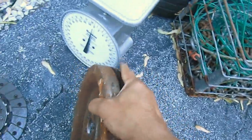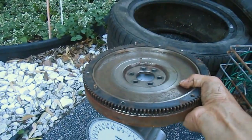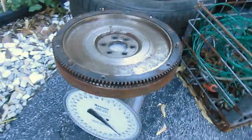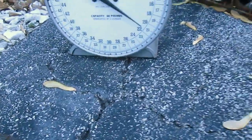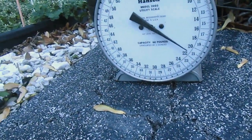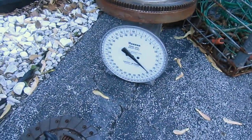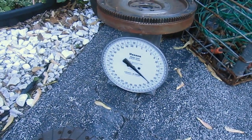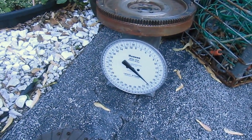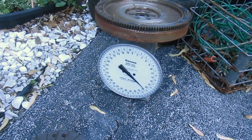Those dampening springs on the back are what are at issue. I'm going to set this on the scale here — the scale is currently set to zero. Holy moly — we are looking at about 21 and a half pounds. So that jives with what you should be replacing your single mass flywheel with. I do not recommend that anyone gets those ultra-lightweight flywheels — the nine pound, eleven pound, fifteen pound, or eighteen pound ones.